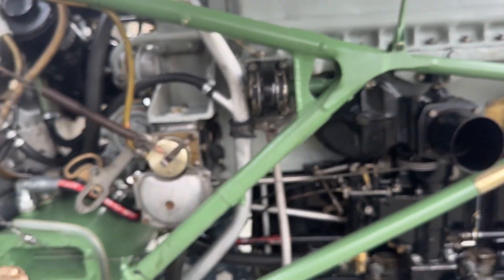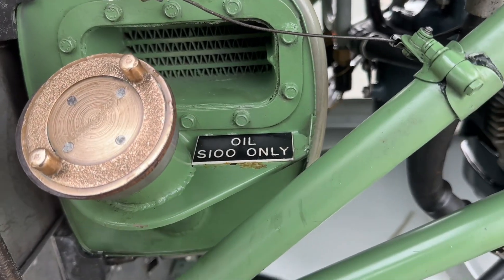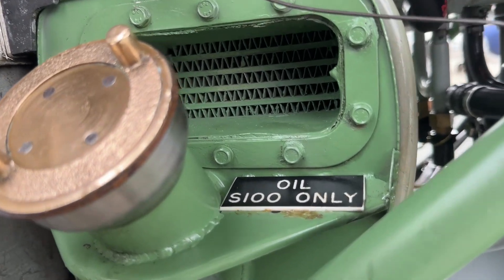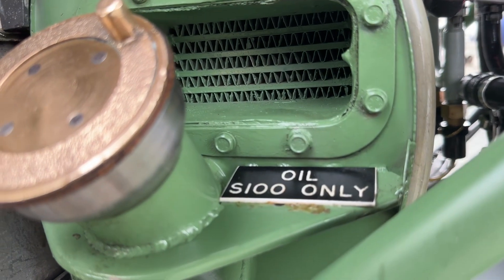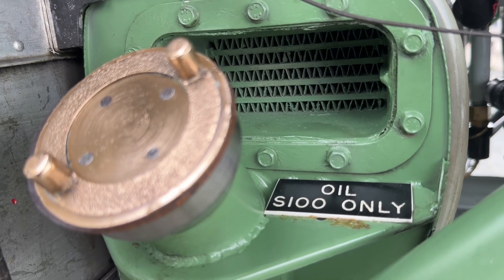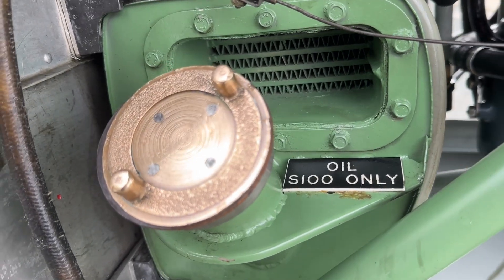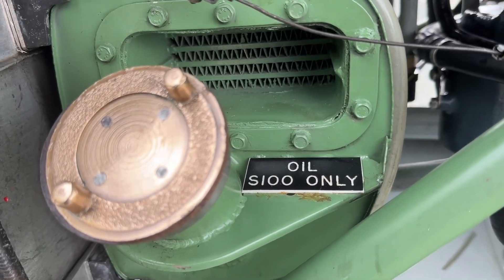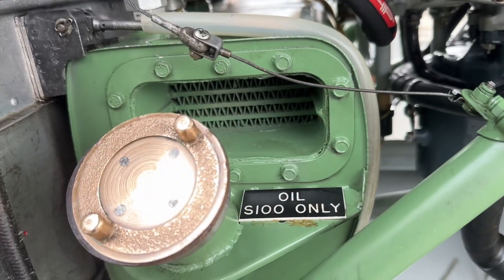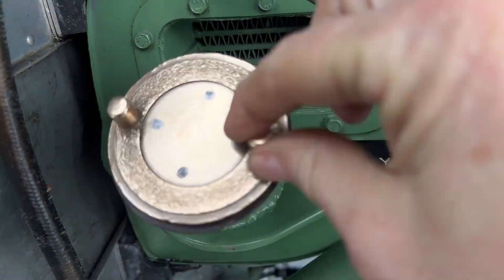We didn't have a good look at the brightly polished oil tank — this is the other side of the oil tank. On the other side it's got a scoop to take air through this radiator, and it shoots out through the side we're looking at to provide some cooling to the oil, so the oil that goes back into the engine is cooler. That's one of the ways the engine is cooled. The other way is through those fins on the cylinders, and the third way is through the fuel itself going in and cooling each cylinder on each charge.